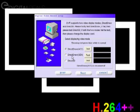And on this screen, this is where you choose your video format. For this one, essentially what you're going to do, if you have a PCI Express or an AGP video card that is 128-bit, then you're going to choose Direct Draw GEN. Typically, if you're using a computer that has an ATI or an NVIDIA card that's been purchased in the past probably 3 years, you should be fine. You choose Direct Draw Gen.